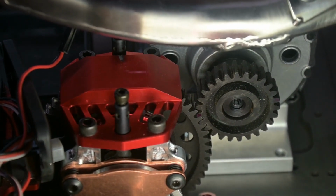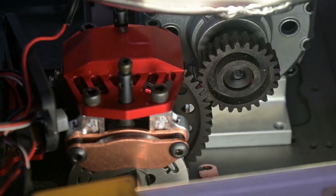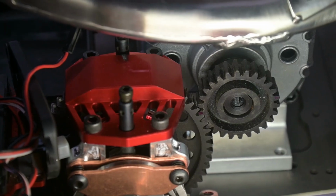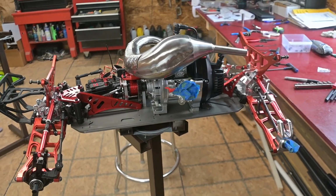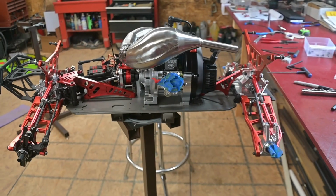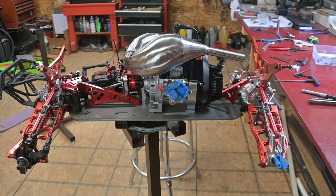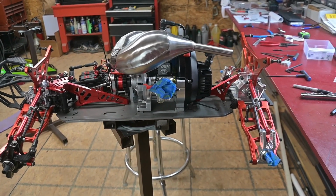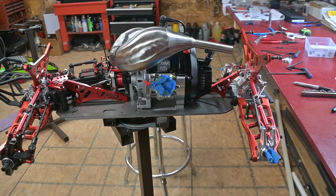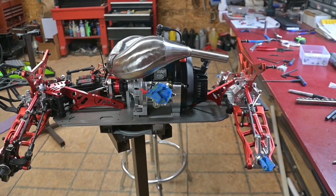so after the next part of this, I think I'm gonna have to build a spacer for the brace. So we'll just work on that next. So it turns out it wasn't the Rovan chassis in this time. In this case, the Rovan's engine mount holes were perfectly aligned. The issue was one of OBR's threaded holes was a little screwed up in the mounting plate. I had to fix it up with a tap a little bit, and good to go.